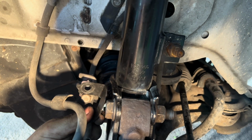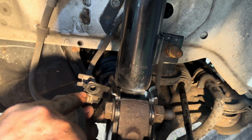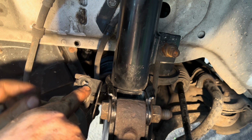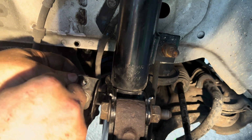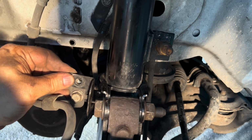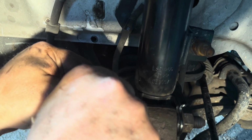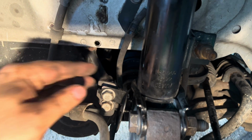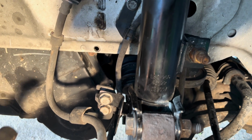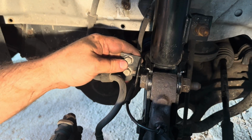The second little metal bracket is the ABS, and it's right here. It has this metal tab, and it's going to go on top of this one, which is the hydraulic brake bracket that I just bolted down. And I'm going to get it started by hand right there. And I'm just going to go from the side with a 13 millimeter socket. Then they're in place. That's good.